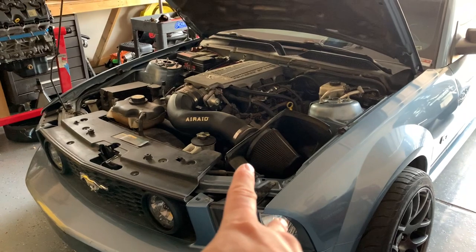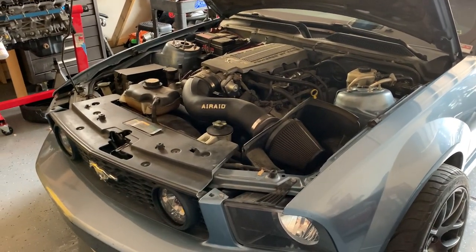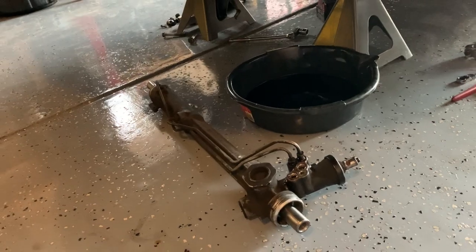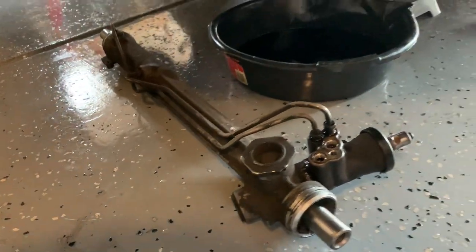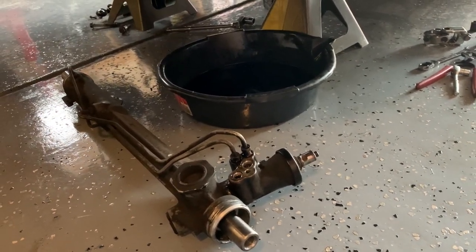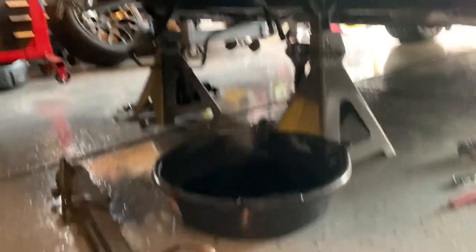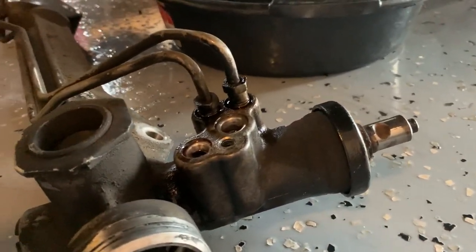So I'm going to show you how I'm going to do that. I'm going to take this rack out, pick up a rack tomorrow, and then wait until I get another controller for this car, but I'll show you the steps along the way. Got the rack out in a reasonable amount of time — maybe 20 minutes. Two bolts, tie rods, and your steering shaft. You don't have to worry about the lines until you get all that disconnected, because they designed it so that it'll drop enough to get to the bolt that holds the two lines on the rack.